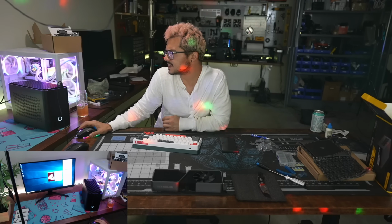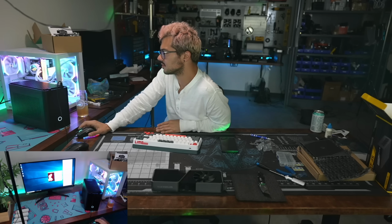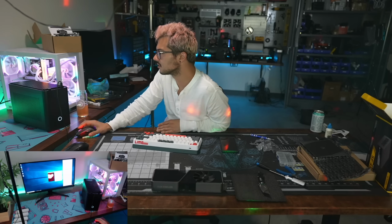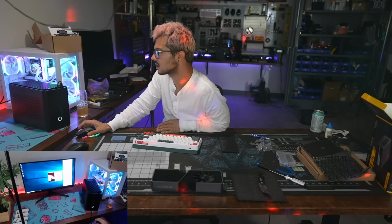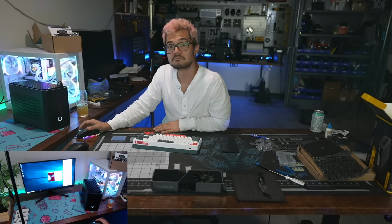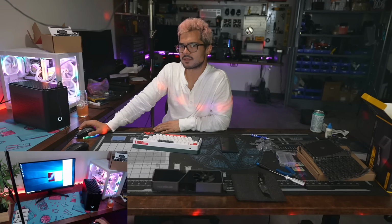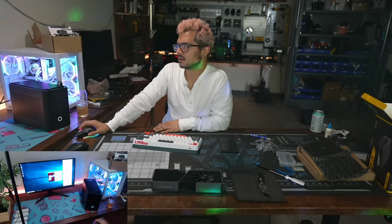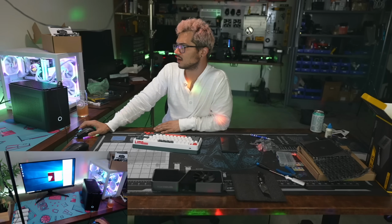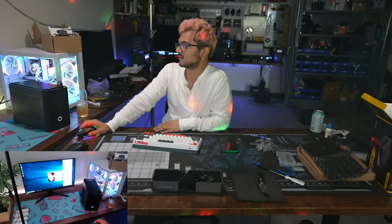We're at 56 C now, almost at 57 C. And CPU temperature is still where it was. 1890 megahertz on the GPU core clock, 2000 megahertz on the memory clock, fan speeds at 60%, and the system is pretty quiet. I can hear the CPU cooler, the Wraith cooler, ramp up a bit when the CPU starts working hard, which is why I said I might undervolt it to keep it a little bit cooler and quieter, but again, I'll have to do some more testing to figure out what the best move is.